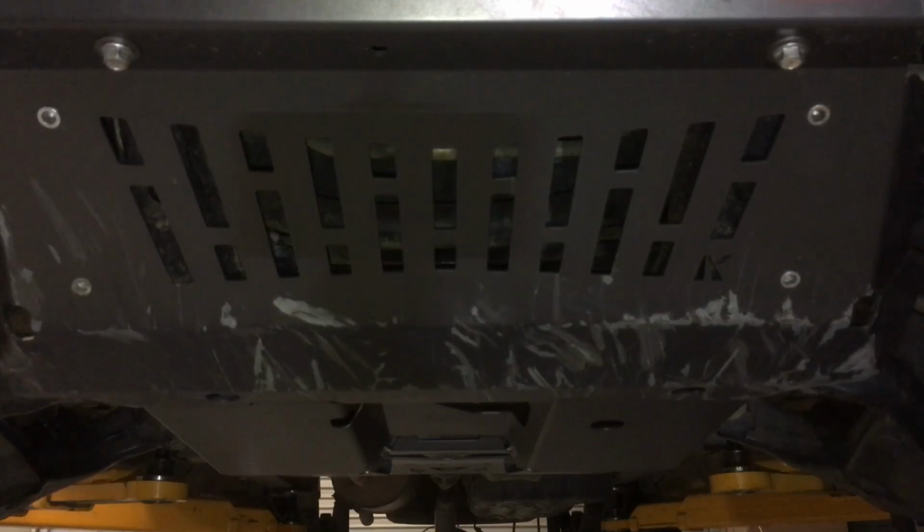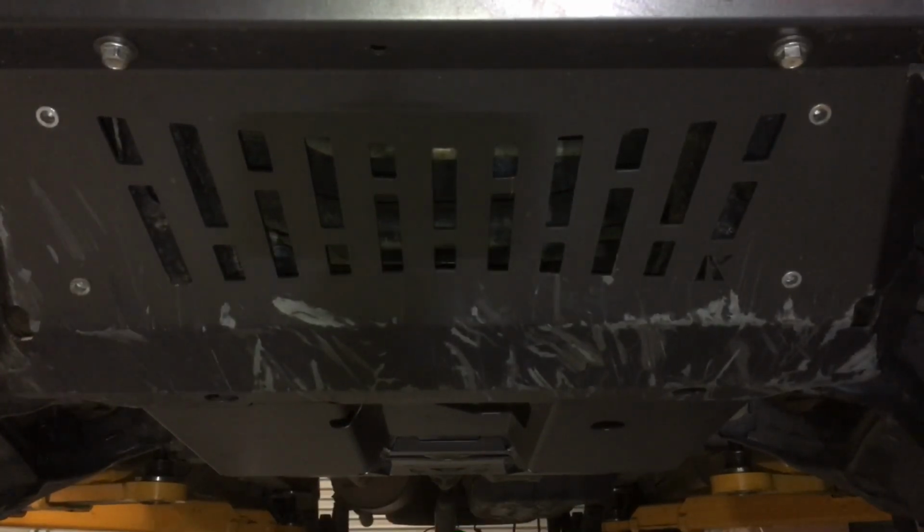But don't go jumping over speed humps, because when those wheels drop and the suspension tops out, it's going to damage that shock absorber. That's why you need that extra down travel when you raise the suspension. I'm not going to go into too much detail. It's quite complicated how much you do and don't need.